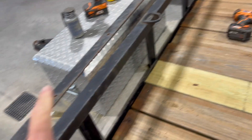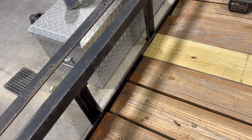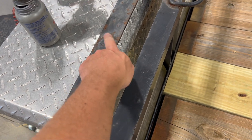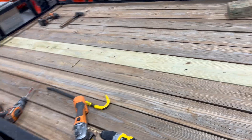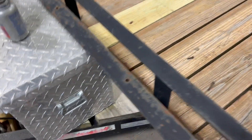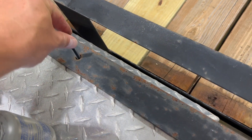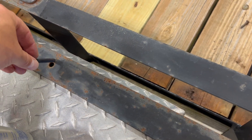I think that's the best idea because I got to take that plate back off, and I'm not drilling new holes through these other boards and putting a bunch of screws when I don't have to do that yet. One thing I do have to do though is drill that one out a little bit bigger because these screws are just a little bit bigger. Whenever I go to put this screw in — I'll just use this hole as an example — it does stick up a little bit, it's not completely flush like I want it to. So I'm just going to drill the center one out a little bit bigger because I know I'm going to be using it for that new board, and that should allow it to sit flush. So we'll go ahead and do that now.